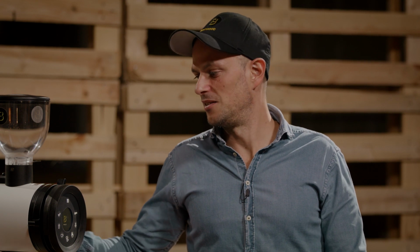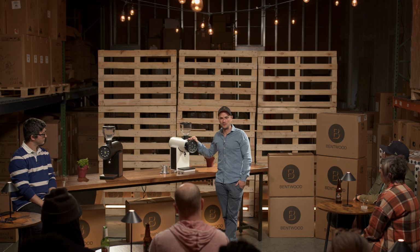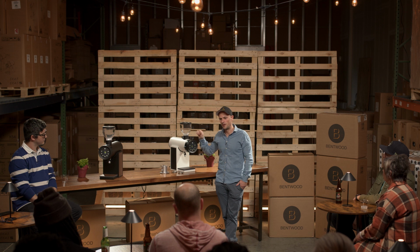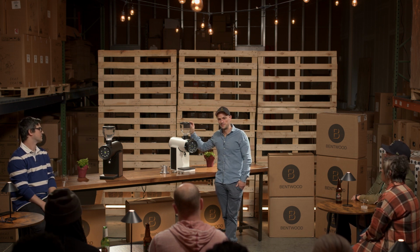With espresso, you will always have more fines that could go somewhere, so it would still depend. And then it depends as well on how oily the coffee is. If you have a medium to light roast, it's not going to be as sticky, while dark roast, especially the commercial grade, really oily ones, are going to be more sticky. They would open it probably once a week. And then how fine you go as well. If someone grinds really fine, like Turkish coffee, I would clean more often.